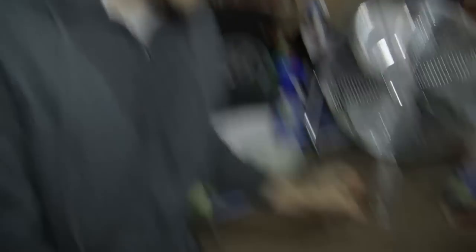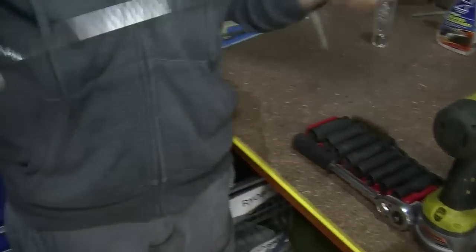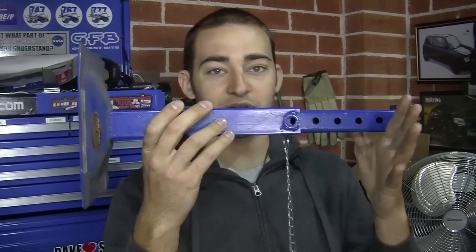These are the tools you're going to need. You're going to need a socket set. You're going to need some pretty hefty sockets — we are dealing with suspension stuff, so it's better to have some of the bigger impact sockets. You're also going to need some spanners. Lots of leverage is good for getting those bolts undone. A cordless rattle gun is always handy. But most importantly, you're going to need some jack stands, because we're going to get under the car. We're going to borrow Mechanical Stig's hoist, but he's over in Vegas, so we're doing it in the garage.